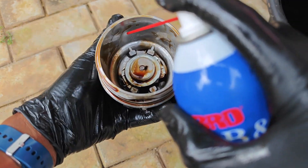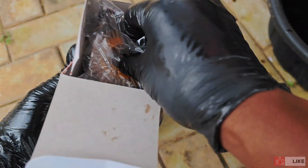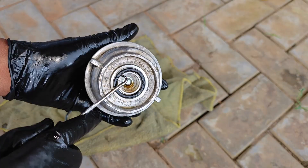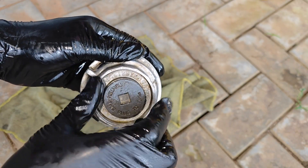Center tubes are very critical to the structure and function of an oil filter. Besides helping return filtered oil into the engine, a missing center tube can lead to the collapse of the filter media, which will result in oil starvation, engine wear, and ultimately engine failure.